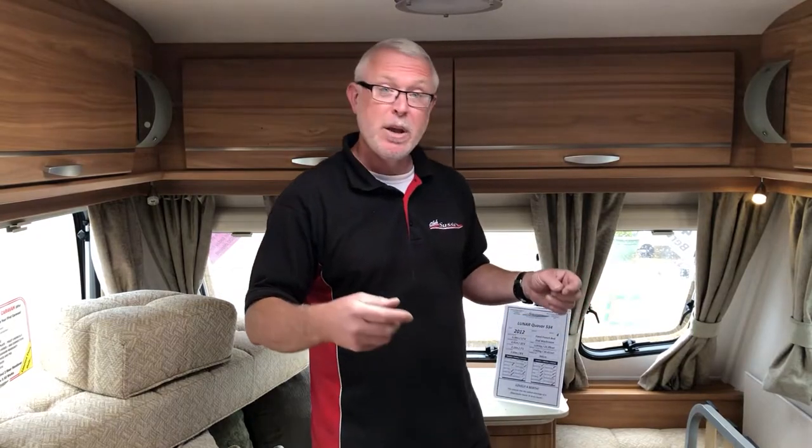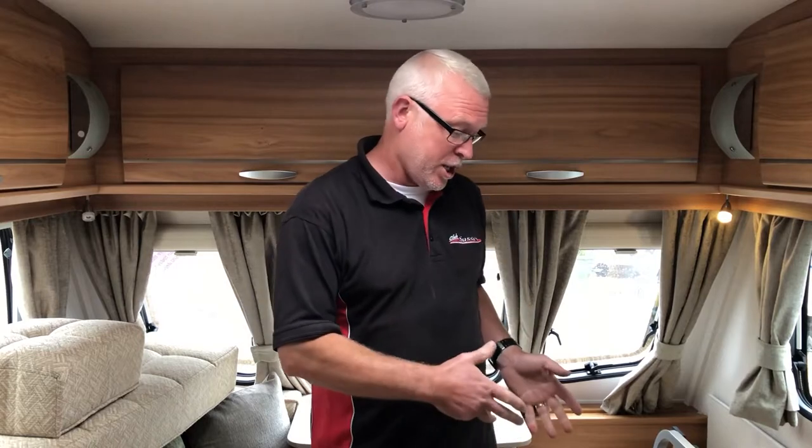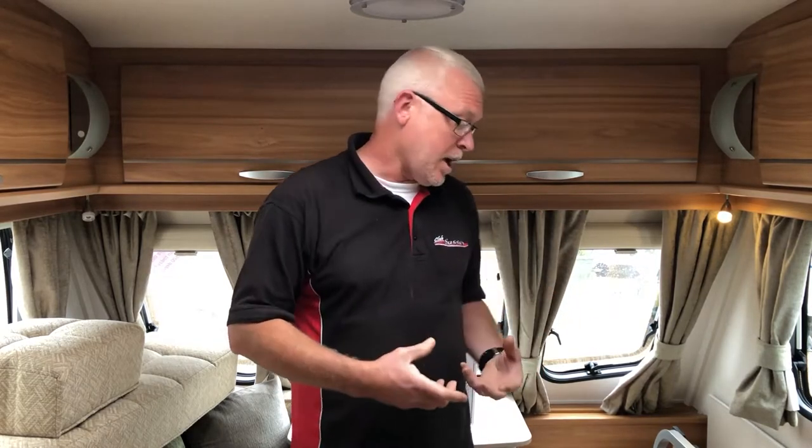Once you've purged the system, I'll show you it's not working correctly and then how to set it up. You should only need to do this on your first setup of the week. The key thing to remember: if you're on a site with hookup this should stay constant, but if you're on a natural site or in a field relying on your battery only, as the battery runs low you may have to readjust the pressure switch. You will have to adjust the pressure switch between hookup and non-hookup.